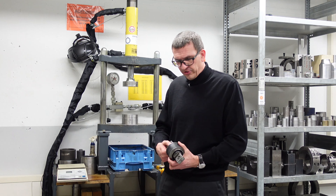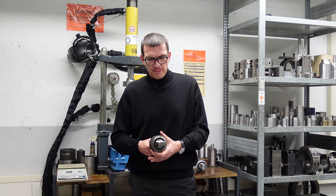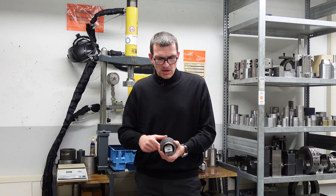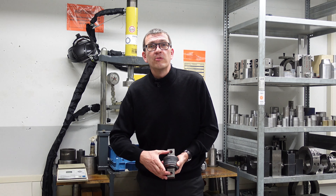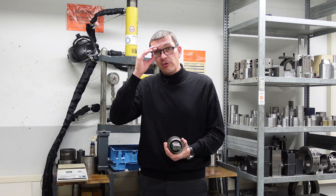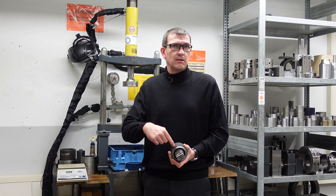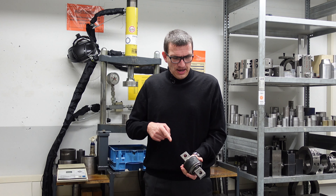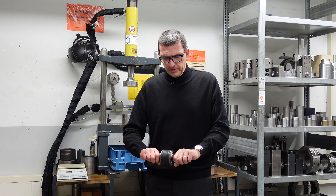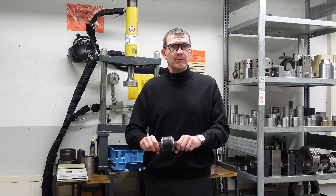Just to give some more mechanical requirements: the fitting diameter of this part is about 90 millimeters, and the distance between the two holes is 130 millimeters. This part is originally designed for a radial oscillating load of around 100 kilonewtons, axial load of 20 kilonewtons, rotating angle of plus and minus 12 degrees, and conical angle of plus and minus 8 degrees.